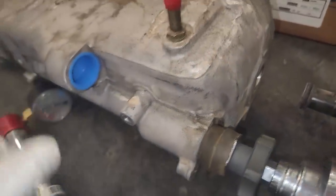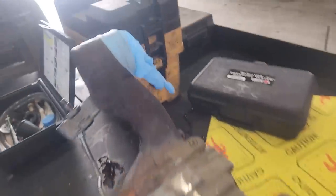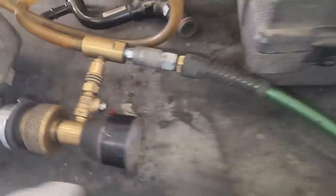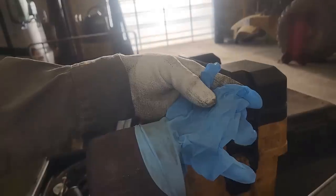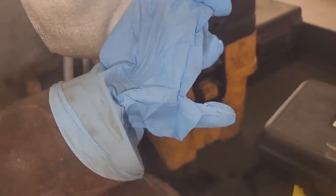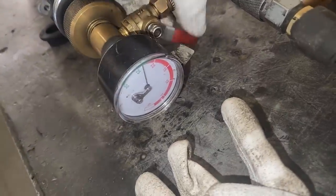So what we were doing here was trying to pressure test it, but these take all sorts of weird special adapters to cap these off that we, as a cap dealer, do not have. I tried my best using some plugs and was only going to build it to one or two PSI, but one of those blue caps blew out. So I decided we're going to vacuum test it instead. I put a glove on there as a test - you can see it's actually sucked in, meaning it's sucking vacuum on the exhaust side even though I'm pulling a vacuum on the coolant side. We already knew the EGR cooler was pulling air in from the exhaust side into the cooling system. I also did a similar test with the engine and EGR cooler off, filling it with water and capping all those lines. The engine itself never pushed any water or coolant out of the exhaust manifold, so pretty sure we just got a bad EGR cooler here, folks.